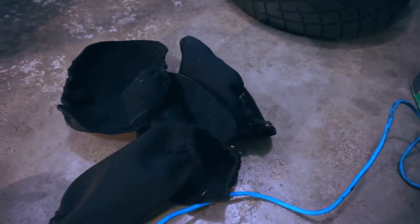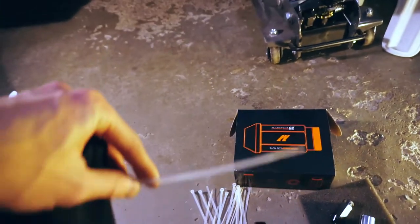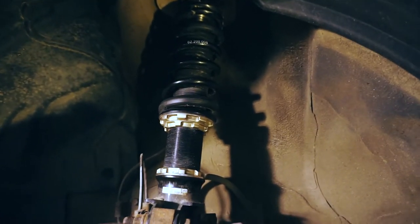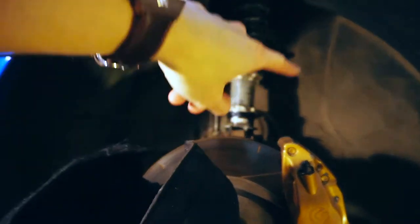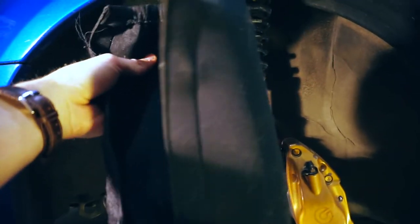All the sleeves are the same size so we're just going to grab one and grab a couple zip ties. They came with massive zip ties, so I'm just taking two normal sized zip ties and combining them. Before you put on your coilovers, you want to grab some white grease and put it on a paper towel and then spread it all over your coilover, just to make sure if any water does get through, it's not going to be trapped inside. Once your coilover is completely covered in white grease, take your coilover cover and put it on, then rotate it with the grease.